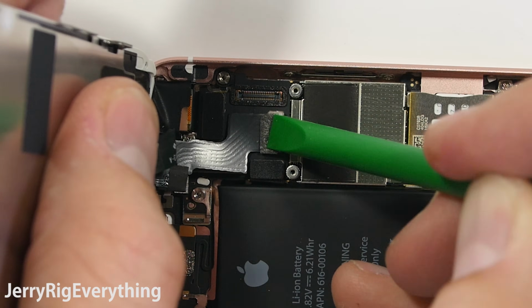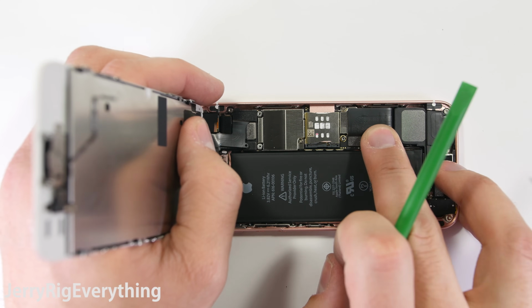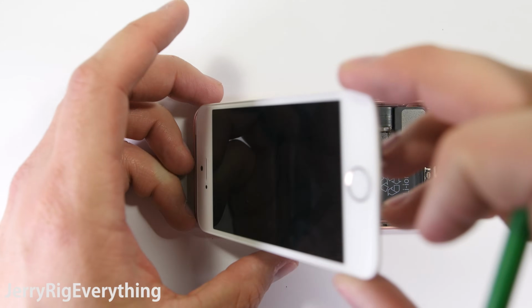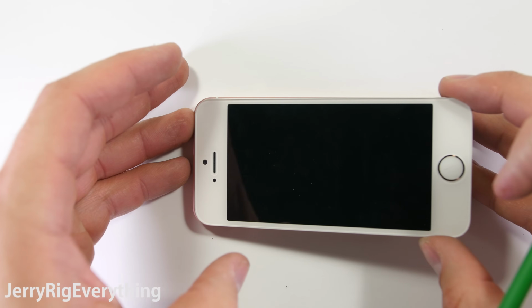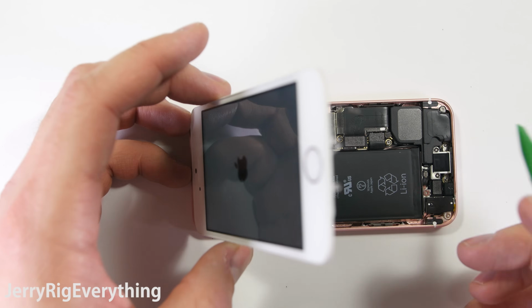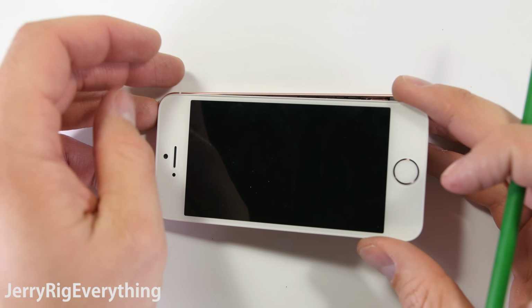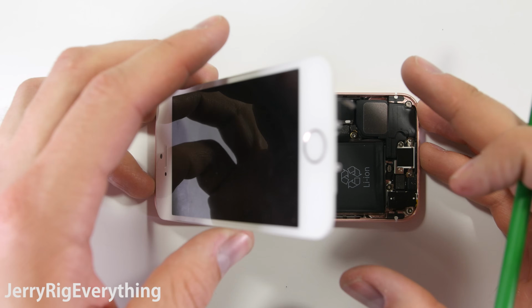Once those 3 ribbon cables are in, we're going to plug in the battery, and before putting the metal plates on, we're going to test and see if the screen works. It should function as normal right now. If there are lines or if your screen is gray, there's a good chance that the ribbon cables do not have a good connection with the main board. So disconnect the battery, pop off those cables, reseat them, and try again. If it's still not working, there's a chance you got a bad replacement screen.